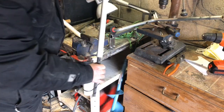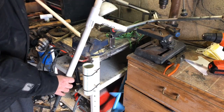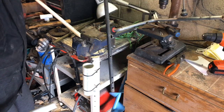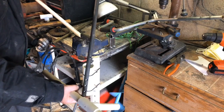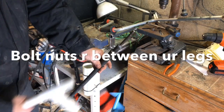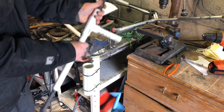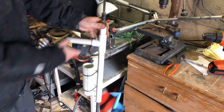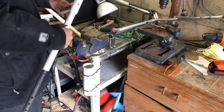Now there's the adapter part that I made. It's just PVC pipe with a T — three quarter inch. Then the pipe that fits inside the auger. I don't know if different augers have different size pipes inside. But I just welded a nut at the end — the drill goes on the nut. Then I welded a collar to stop the pipe from going up and down, and it jams in between the auger. So you don't have to worry about losing your auger because you're always hanging on to it. It's bolted in at the bottom.